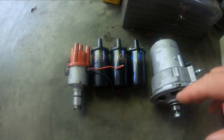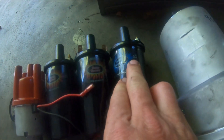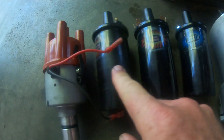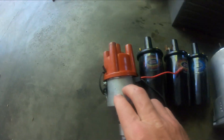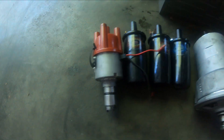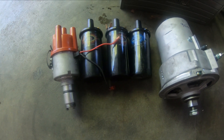I tried three Flamethrower coils and then the Bosch — the Bosch would also lose charge. I have coils at 0.32 ohms, 1.5 ohm, and 3 ohm, but I don't think it was the coil. The distributor was the Flamethrower 3, and something weird seemed to be going on — the engine was getting really hot and I wasn't sure if it was advancing properly.